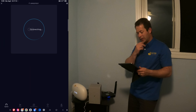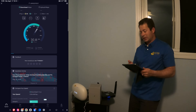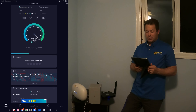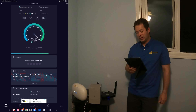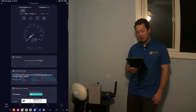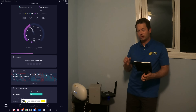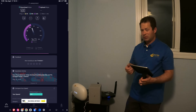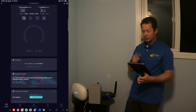Let's do a speed test to see how this compares. This is 5G NSA with external antennas on the Main Event. We broke past the 500 Mbps barrier with this one still in 5G NSA mode. The upload really varies based on your signal and what type of performance you'll get with each configuration — that's why I always encourage you to play with different settings. You can watch my videos or message Chester Tech Repair for help.